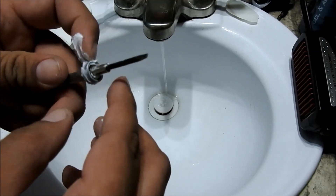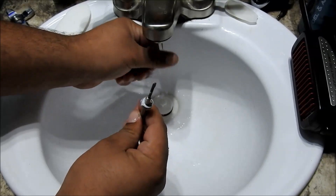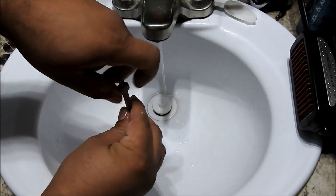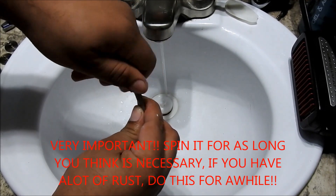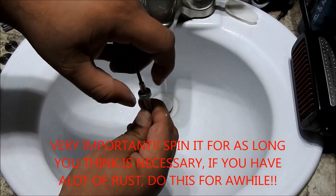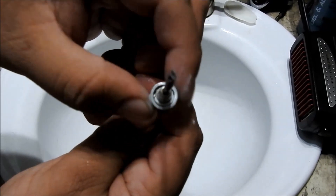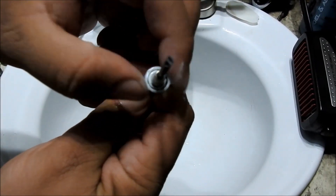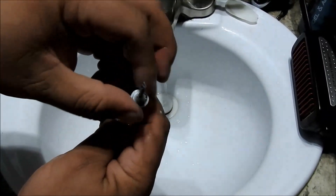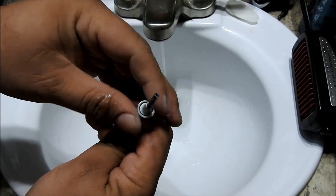Now this is going on pretty thick right now. What you're going to want to do is just spin that a little bit in your hand — just keep the bearing going around and around. If you don't have a screwdriver like this you can hold it between your fingers, but I find doing this is a lot easier. You're going to see that inside the races the paste is in there and it's spreading around. You can get a little bit of water, put it inside, and you're going to feel the grit of that toothpaste.